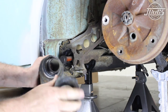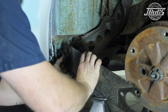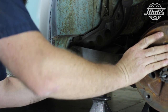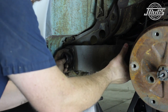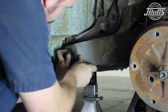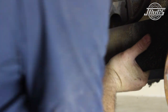With the spring plate removed, the old bushings are removed from the cap and the torsion housing and a new bushing is installed on the inner portion of the spring plate. The spring plate is set back in place on the torsion housing, noting our scribed mark. We pivot the spring plate up while feeling the teeth on the splines of the torsion bar, moving the spring plate up one spline at a time, two splines total, then pushing the spring plate onto the torsion bar and into the housing. The spring plate will be hard to press in fully because of the new bushings, so we hit the spring plate a bit with a hammer to get it set in place.